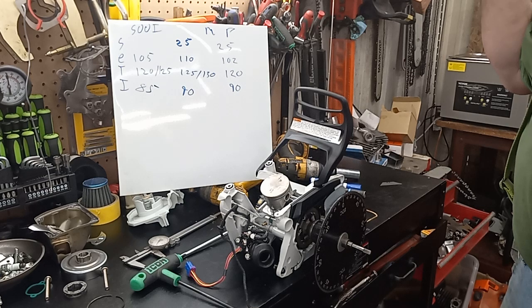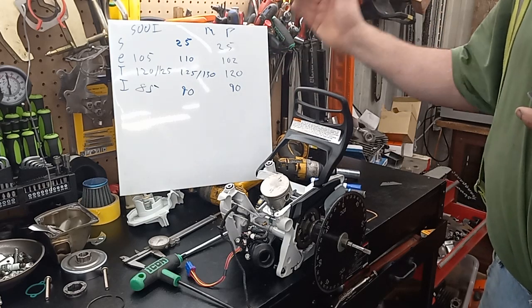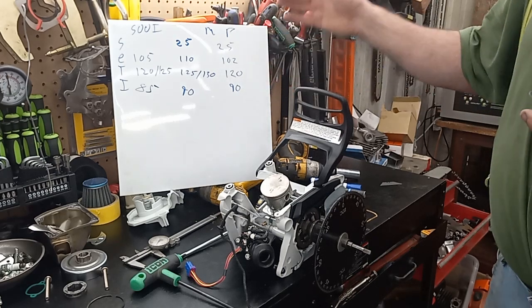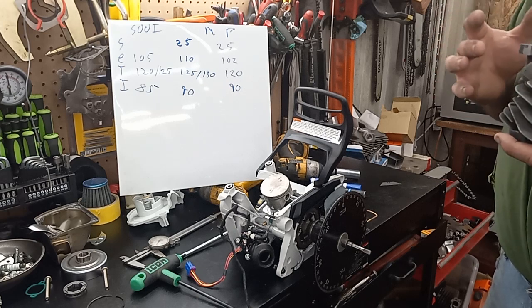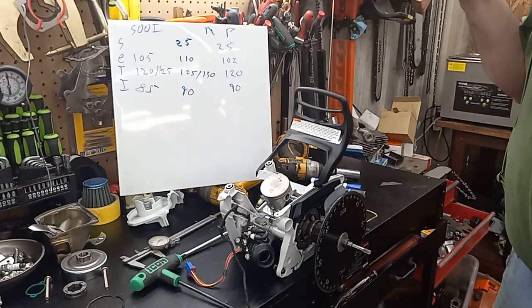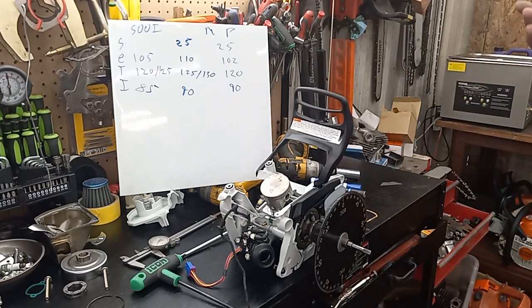He's got my 102 roof 500 and loves it, so I wanted to stick with something I think he would love. I stayed with 102 roof on this, gave it 120 transfers, and left the intake at 90. Yes, this is short blowdown, but I've had to explain this to people — front-fed saws, any saw that has compromised transfers, falls in that category. Stratified saws seem to favor shorter blowdown.